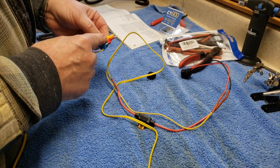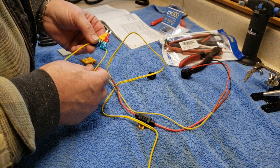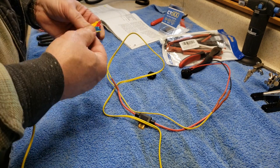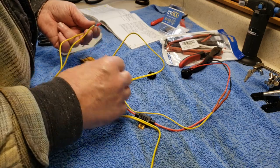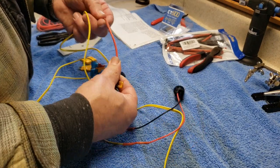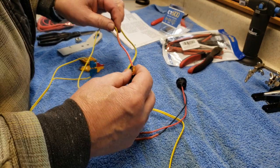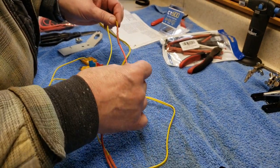I got one side of it painted red — that just tells me which prong is going to the hot lead, and I'll show you in the fuse box how I determine that. It's also connected to the wire with the black on it, so it'll run all the way to the inline fuse. That same black wire is going to be tapped into this inline fuse. You don't want to do it without a fuse, otherwise you'll fry your wires all the way through to the battery.